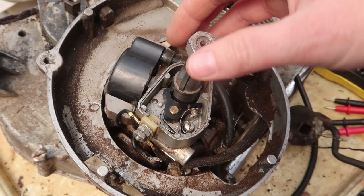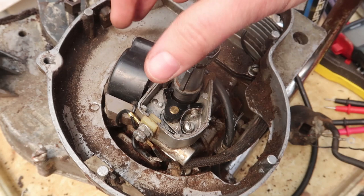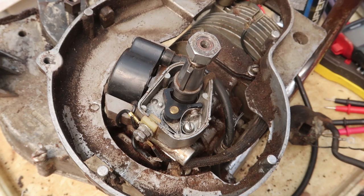You can think about this as if it's a power transformer. Basically, this is a step-up transformer, just there is no primary winding. The primary winding is replaced by the magnet inside of the flywheel, because the primary coil creates the magnetic flux, and the secondary absorbs the magnetic flux and creates higher voltage. So with this, you're generating that with the flywheel.